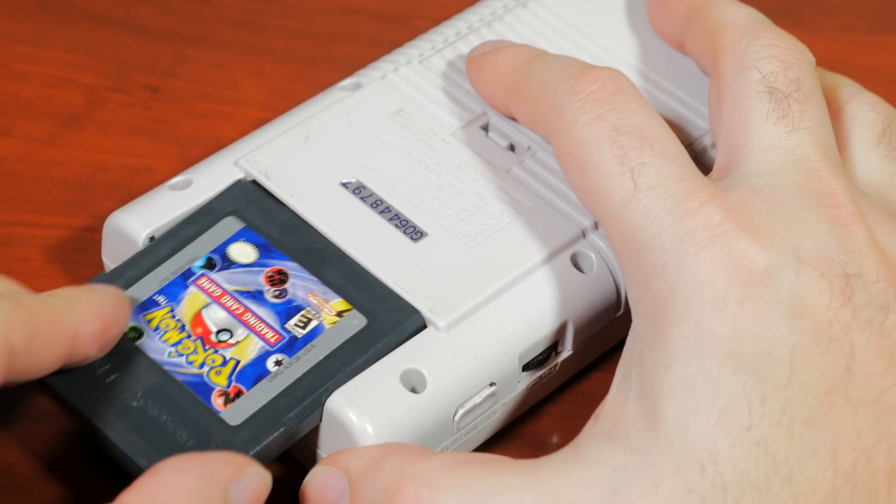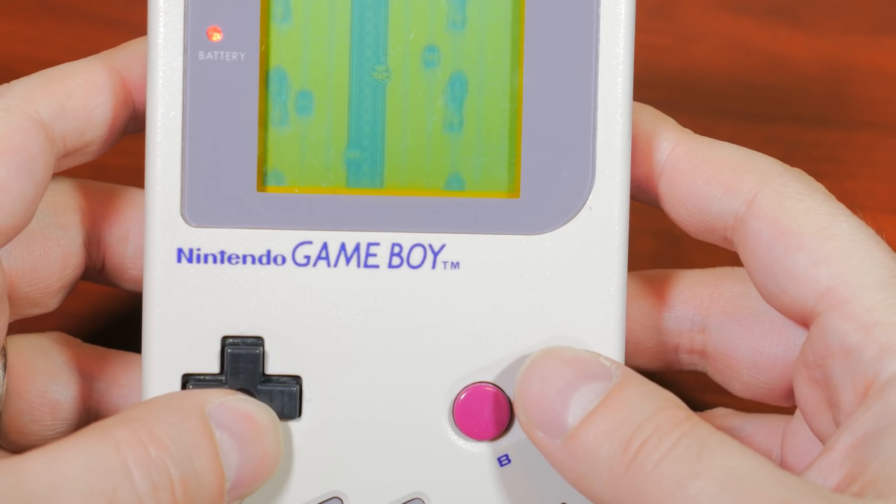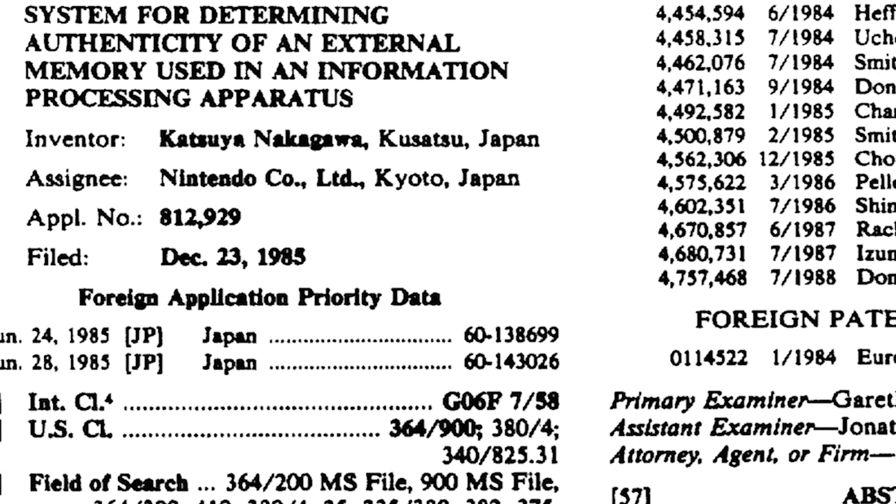Powering on a Game Boy without a cartridge inserted results in the Nintendo logo being completely blacked out. This can also happen if the cartridge connection is not making good contact with the Game Boy itself. This is normally a visual cue to let the user know they have to clean the connections of the cartridge and try again. What's interesting about this boot process and the Nintendo logo is that the logo must be perfectly legible without any pixel errors for the game to boot. If there are any visual glitches, the Game Boy will just sit at this screen. On first glance, this might seem like normal cartridge behavior, but there's actually a very clever form of lockout that Nintendo has architected for the Game Boy.